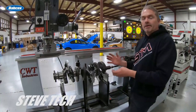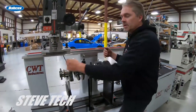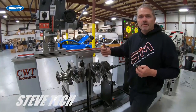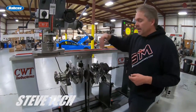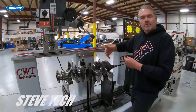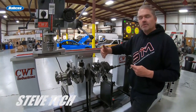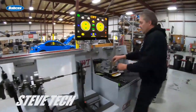Good quality stuff means the balancer and flex plate are neutral balance — no weight added — perfectly balanced round pieces of machined material. There's no need to put weight on the balancer or flex plate. You always do balancing in the crankshaft, because you want to be able to change the balancer or flex plate without having to rebalance everything. That's why you do all your balancing in the crankshaft — so those components are interchangeable. You can put 50 different balancers on and it will never change the crankshaft balance.